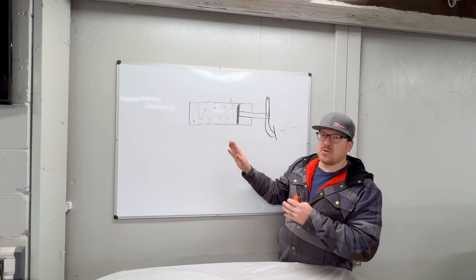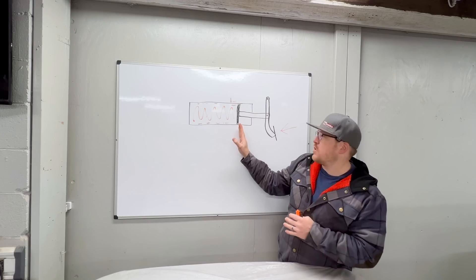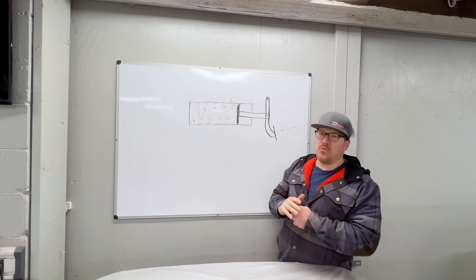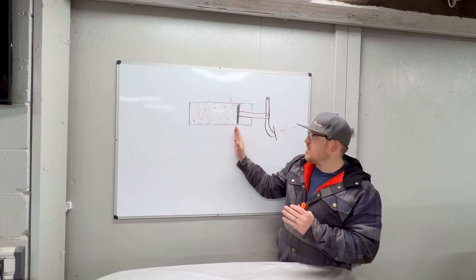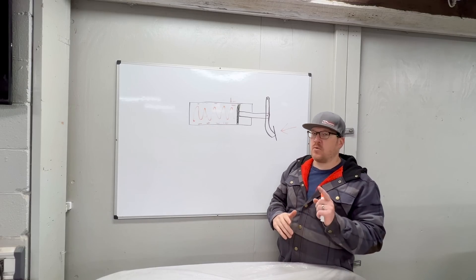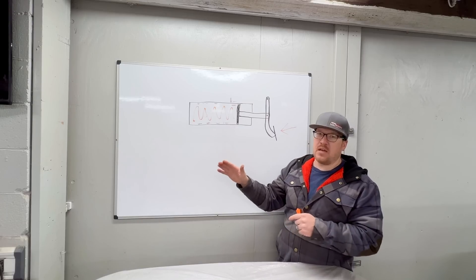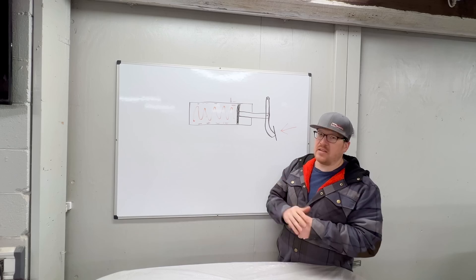The situation on my master cylinder is a bit different because my piston sat in one position for at least 24 years — untouched, unmoved. The fluid accumulated a lot of moisture, so I have rust and corrosion all the way down. That's why I had a very inconsistent, intermittent pedal when we were bleeding the brakes. It seemed to work pretty good on the test drive but finally gave up again, which is why I'm addressing it now.